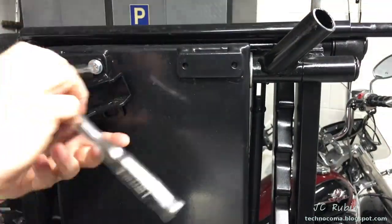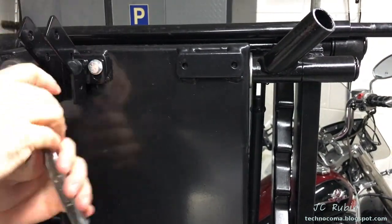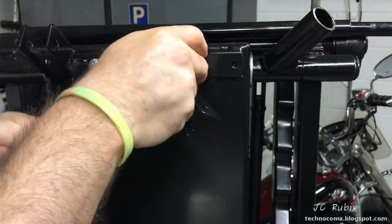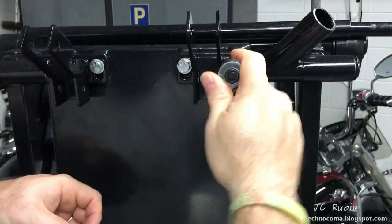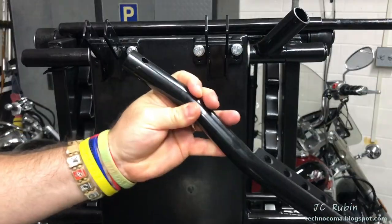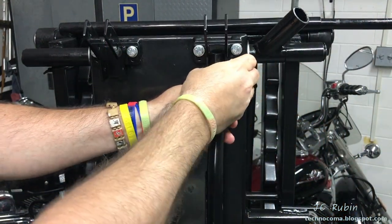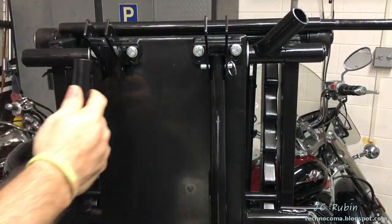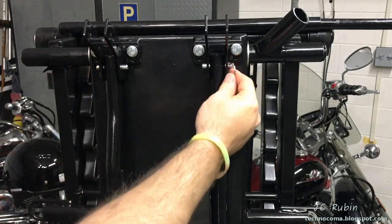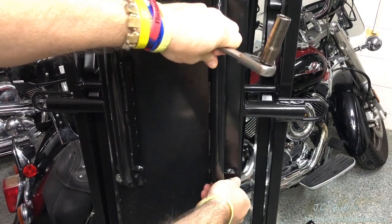The front wheel loop brackets are affixed with the 9/16 hex bolt and washers, initially offering some resistance due to paint over the threads. All the brackets up front allow for adjustment, so I'm keeping everything up front loose until all the pieces are fully assembled. The manual calls out a hex bolt for the guide rail fitting, but it's actually a D10 pin — the manual must not have been updated, this must be a running change. The bottom of each bracket will be loosely fitted with a 9/16 hex bolt.